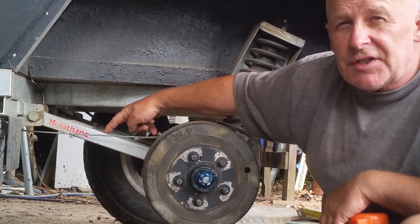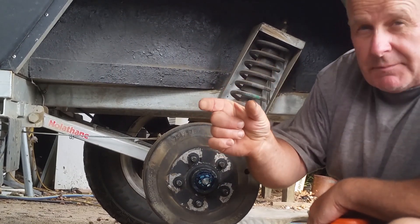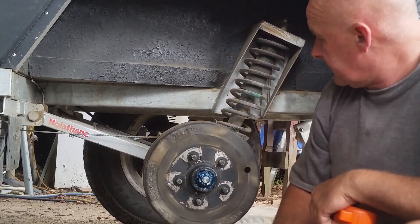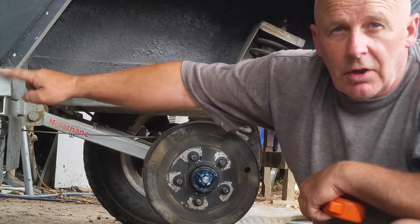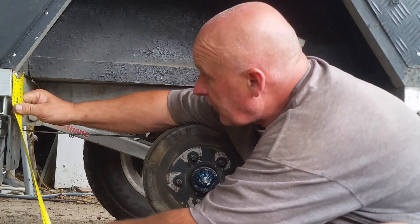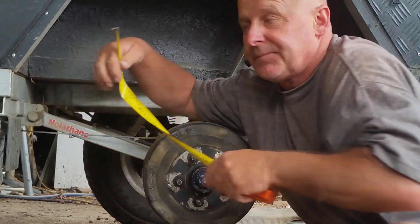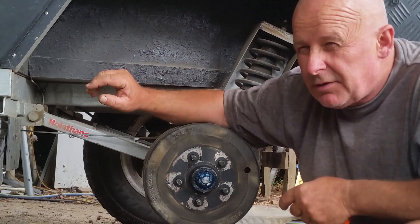The materials I've used for these arms — I didn't go as heavy as some people do. The axle tube is 50 millimetre by 50 millimetre square, and I did use the 6 millimetre quarter-inch heavy wall because it has to be that size for the stub axle to be a good fit into it. For the arms, I've used the same material as the perimeter on the chassis rails — a 2 millimetre thick wall and dimensions of 63 mil by 38 millimetre.